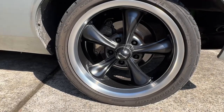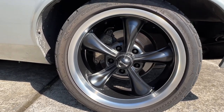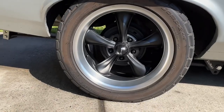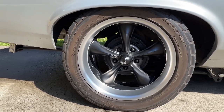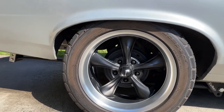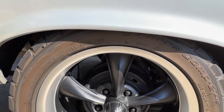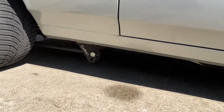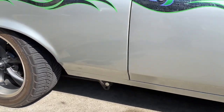It is sitting on some 17-inch Riddler wheels — I believe they are 695s. These are disc brake in the front and we just have drums in the back. Currently I am needing to upgrade my rear end. The rear end in it currently is out of a '69 Camaro — we just needed a rear end during the build so we stuck it in, but it definitely needs to be upgraded. The problem is I want to put disc brakes on it, but that will push my wheel out a little more and I can barely get a finger in there as it is, so we'll have to do more modifications when we go to disc brakes in the back.